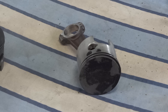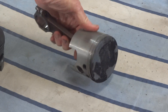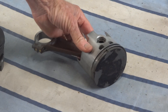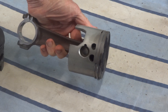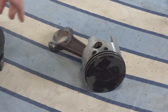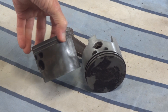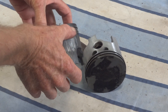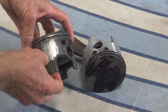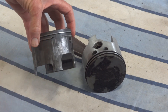Welcome to the Mercury Piston Show. That's the piston out of number one - what I'm calling number one - which doesn't look that bad. There's absolutely nothing wrong with it, not detonated. There's the problem. That's the piston out of number three, the one down the bottom on that side. That ring's seized in place. Scuffed on the bore. Rooted, basically.